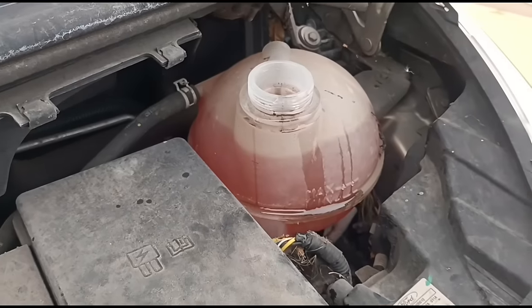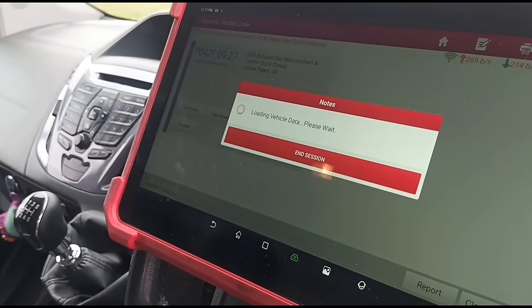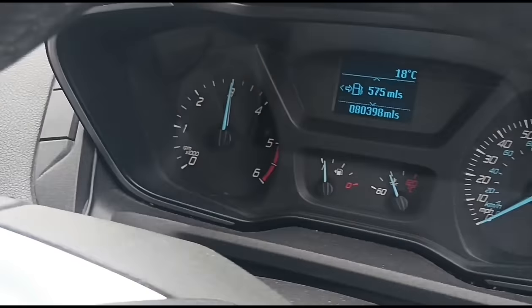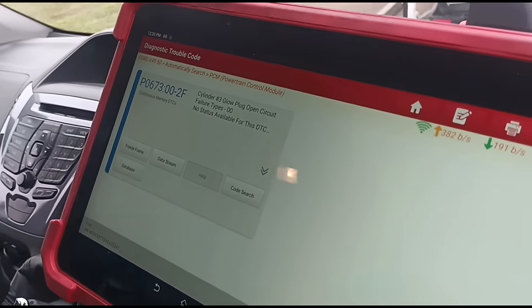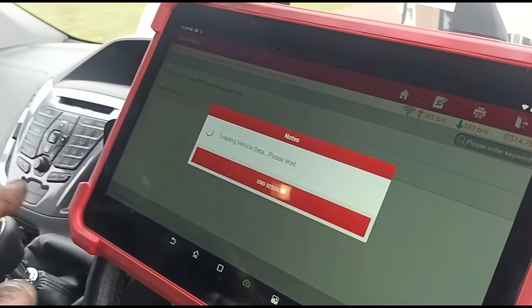Now I've got that full, I'm going to come back in the van and clear that fault code. I'm going to use a pedal depressor to hold the revs up. Holding the revs there now, we can see that the EGR valve fault has gone. We've got one there for a glow plug on cylinder three — that would be done on a separate video if the customer wants.